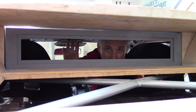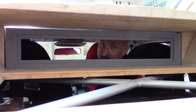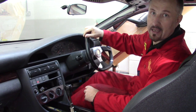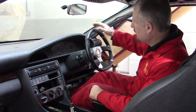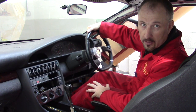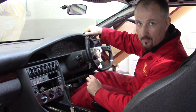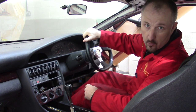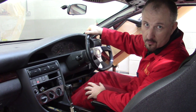We've got the steering rack and the steering column all sorted out — so your steering's all done yet? Well, not quite. There is one thing we've got to think about, and that's the steering wheel itself. When you're building a low-slung supercar, one of the things you're going to be struggling with is getting in and out of it, so the steering wheel might get in the way. One of the things you can do is put a smaller wheel, perhaps a flat bottom steering wheel. This wheel is just an aftermarket cheap wheel I got off eBay — really for mock-up purposes. Depending on your own country, steering wheels have to pass certain rules and regulations, and they've got to have a British standard stamped onto them. I'm pretty sure this wheel would fail any test. It's about 350mm in diameter.